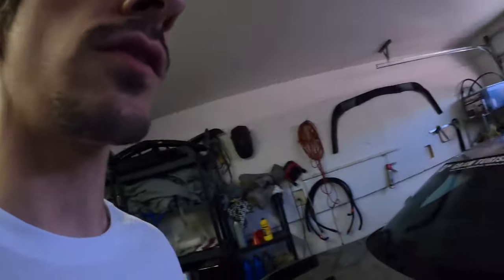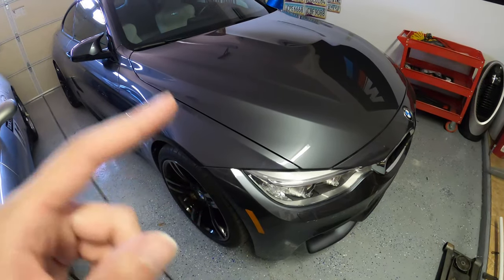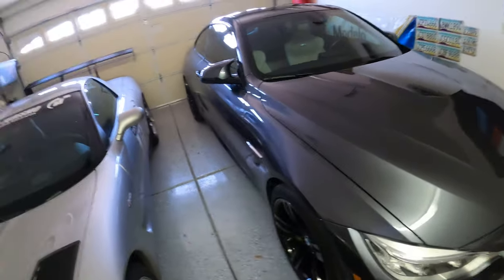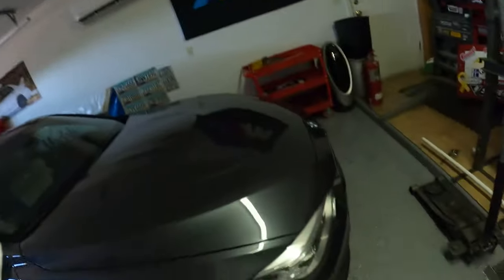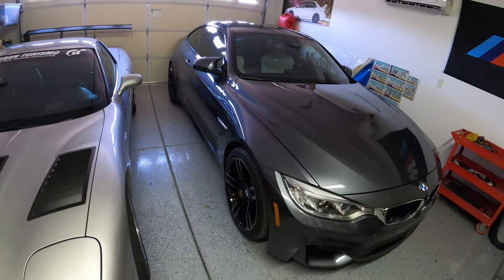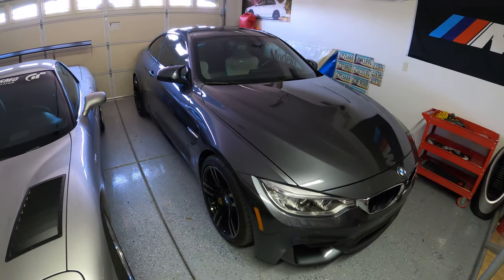The other thing, I bought a tuning cable, the E-Net cable for these, pretty cheap. I'm actually probably going to be doing an episode on how to code these cars, because you can actually do a GTS/CS Club Sport flash on these base models. It completely changes the differential, transmission, and engine coding, and makes everything a little bit more aggressive and refined, and really wakes up these cars, apparently. So coding is coming first. And then, yeah, just gonna kind of build the car as I go.